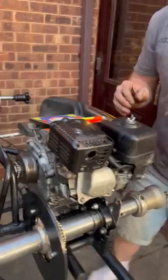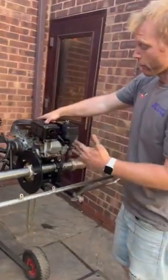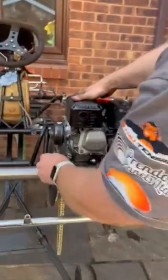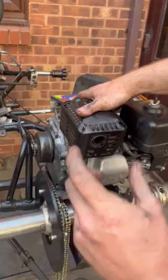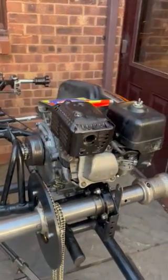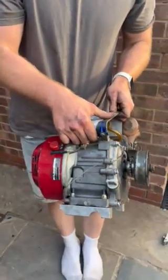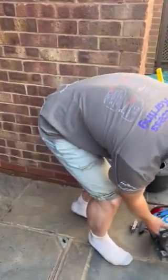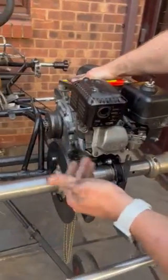Before we do that, we'll need the chain attached to the engine and we'll need to ensure that the engine and the sprockets are aligned. As you can see here, I have pre-aligned it, but in this instance what we've had to do is flip the clutch around. The clutches can work in both directions — the clutch drums are the opposite way around, and that's perfectly fine to do in order to make sure you've got the right level of clearance to get the sprocket aligned. In this instance, we flip the clutch.